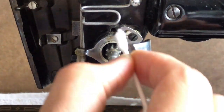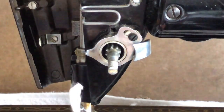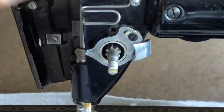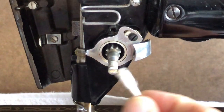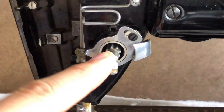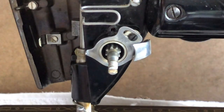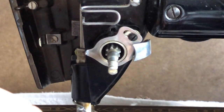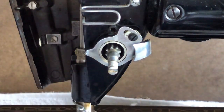I would leave yours be unless you're having issues with lining up thread. If you ever take this off, photograph the position of this little bracket piece on that screw. I'm taking off a little bit of old oil and getting access to any dust or dirt back here with a flattened cotton swab. There's just a little bit of dirt — not much, because it's mostly sealed. Nothing like the feed dogs I showed you on this machine.